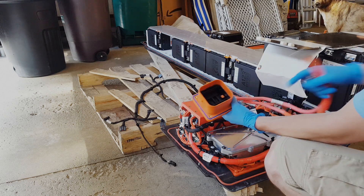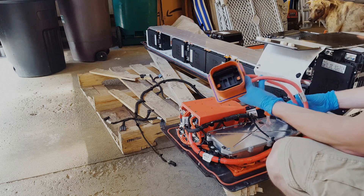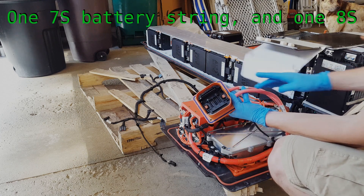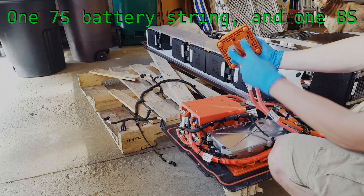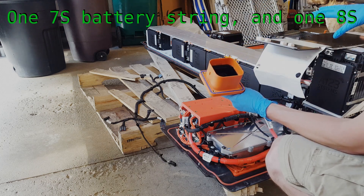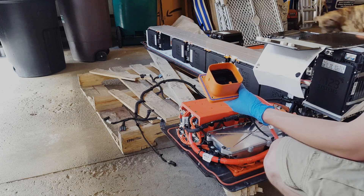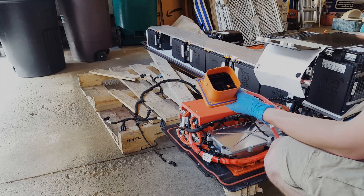This connector came like this — it was not connected at all; there was nothing in it. I measured 160 volts from the main negative to this, and then from this connection to the main positive was another 160 volts. On the backside, these are electrically isolated. So I'm pretty sure without this connector, it's actually wired up as two 160-volt series connections. So if you don't find 350 volts on this — because these are stored at like 23 volts a piece — that's probably why.